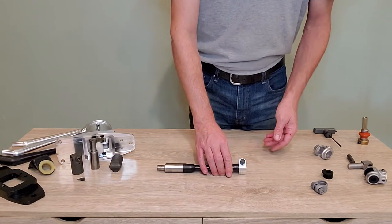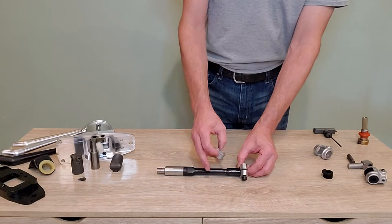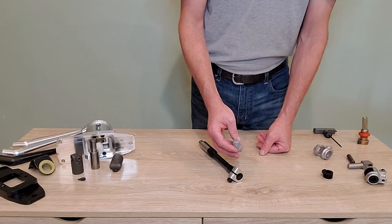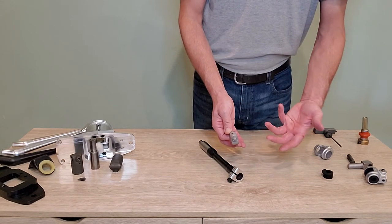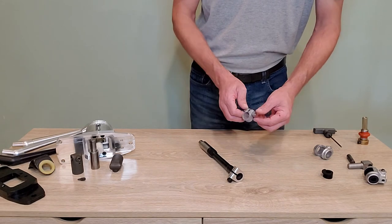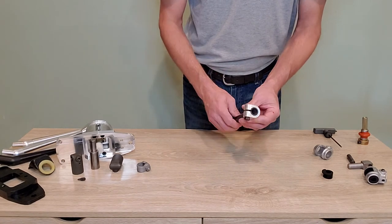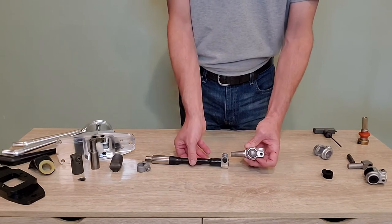Moving on down the line, we get to the area in front of the back seats under the hatch where the shift coupler is. We have the shift coupler clamp — this is the J-West version, and here's the factory version. The stamped steel has a nut and a bolt; these tend to become pretty deformed. When doing your shift coupler adjustment or alignment between your shifter and transmission, you have to get inside that tunnel with two wrenches and try to hold the coupler and shift linkage — it becomes a dance. Our machined aluminum clamp just has one bolt threaded right in, so it makes that adjustment much easier.